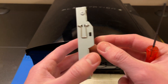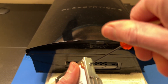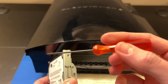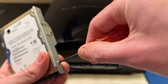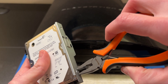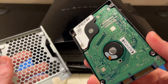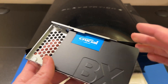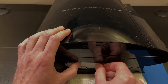Once you have your drive out, there will be four screws that secure it in the little metal cage. Remove these four screws using a Phillips head. Note that these are actually JIS screws, so it can be difficult with a Phillips. If you're having trouble, grab some pliers, bite the outside of the screw, and twist — that typically helps. Then slide in your new drive, replace the four screws — you don't need to tighten them as much as they were — put it back into your PlayStation 3, replace the blue screw, and secure everything back together.